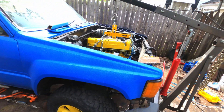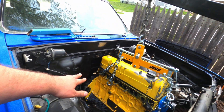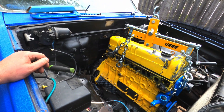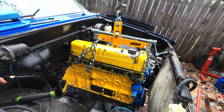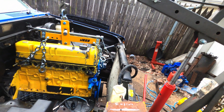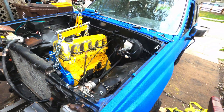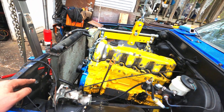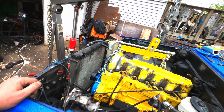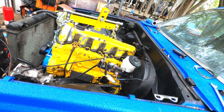We're back — I had a visit from a friend for a little while, nice break. We are mounted up. We've got the transmission bolted to the engine, mostly — four bolts in, they're together. I have the tilt where I want it, centered side to side, and ample room to my radiator. That's the Mercedes radiator and I haven't decided if I'm going to use it or use a three-liter V6 one.